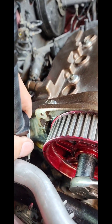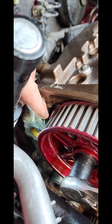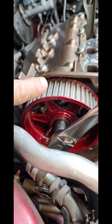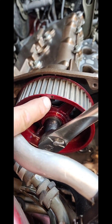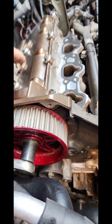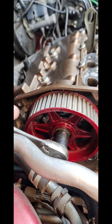Setting the rear cam is a little bit more difficult. The notches are set up just like the front cam with the casting in the head, but you really can't see it because of the angle — it's way down there. So what they did is give you two notches on the underside of the rear valve cover that line up with two dots in the cam gear. The problem is you have to rotate it and depress the number one intake valve, so you have to pull this up to line up everything.